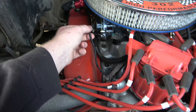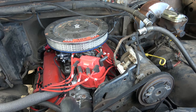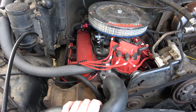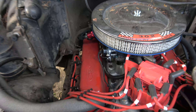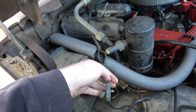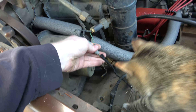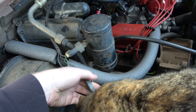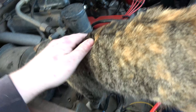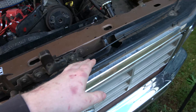The choke here gets power from the same source as the distributor. I haven't had any problems doing it that way — I don't think the choke draws a whole lot of power anyway, so that's worked out pretty good. The other thing out of the engine harness is a wire for the AC — I use that to control another relay which runs an electric fan.